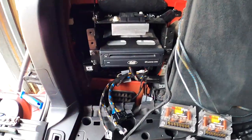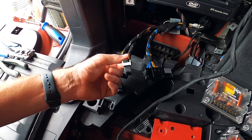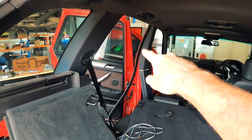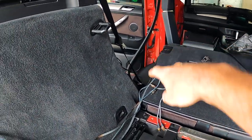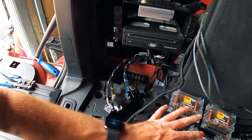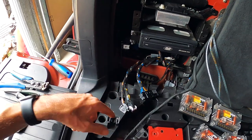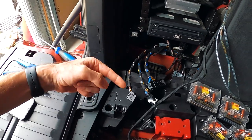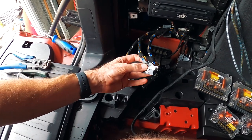The main cables are obviously coming back. This part is going to be the more time-consuming part of the install. I've got to check these wiring pinouts and hook them all into the crossovers. As I mentioned in yesterday's video, I need to separate the channels for the tweeters, mid-range, and woofers in the front, then the tweeter and mid-range in the door, and then the woofers in the doors as well. So we're going to have 10 channels of audio — 20 wires from this harness connected into those, then those get connected to the aftermarket amps. I'll put all the colour pinouts and pin diagrams in the description.